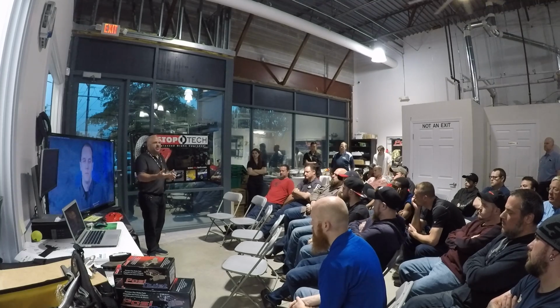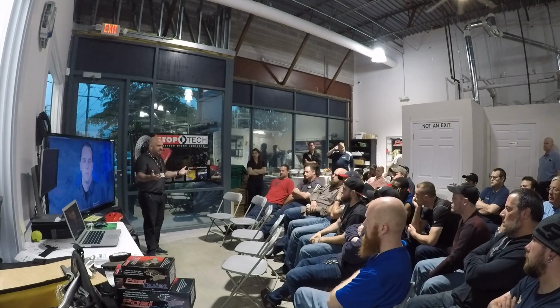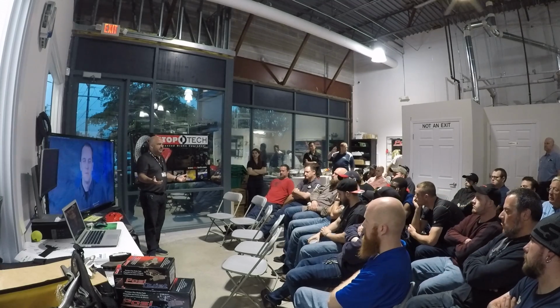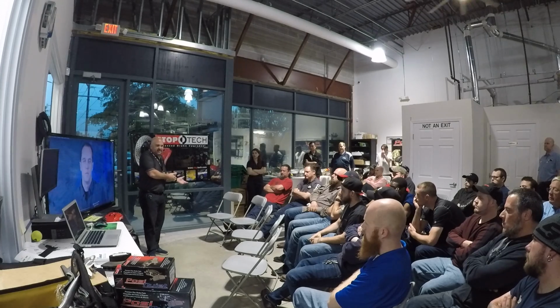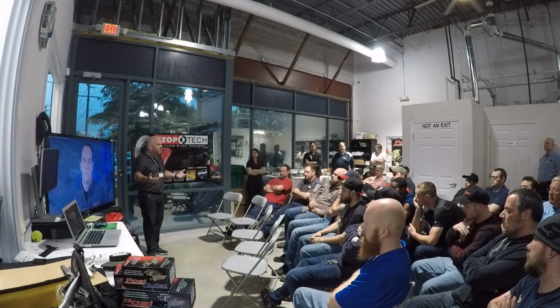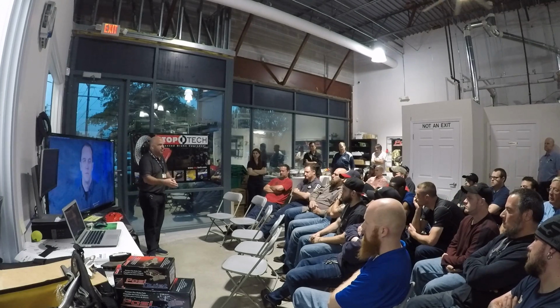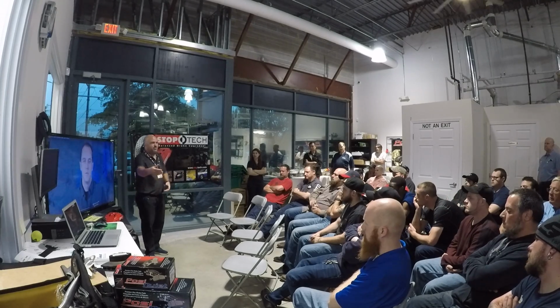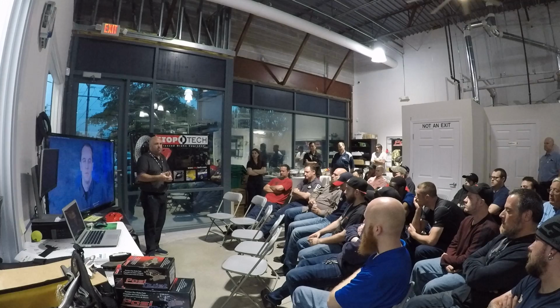So by the time 2 to 3 months goes by, they're coming back to you going, my dash is shaking. And you ask, why didn't you come back sooner? And they say, well, it wasn't that bad in the beginning. You think about it, if a rotor was going to warp, it's not going to warp and then get worse and worse every week for 3 months. If it did work that way, it'd be more like an emergency braking situation, and they wouldn't be getting one of those every single week that's going to make the rotor warp more and more.